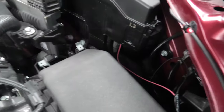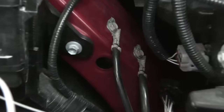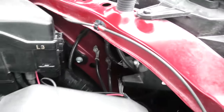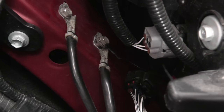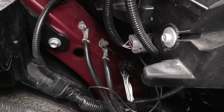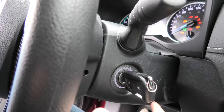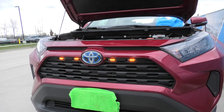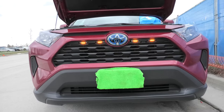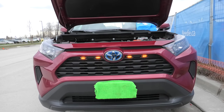Our wire exits underneath the fuse box. The grounding wire will be connected to one of these two bolts located on the body of the vehicle — these are the dedicated grounding points. Here we have our grounding wire connected to the existing grounding wire, and right now we will tighten the bolt. The fuse we are using only becomes active when the key is in the ignition-on position, and that's exactly when our lights will turn on. This is how our lights look. If you guys like the product, I will leave the link in the description — check them out. Thank you for watching guys, we'll see you in the next video.